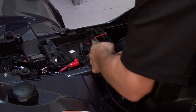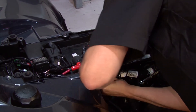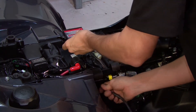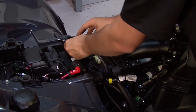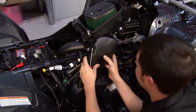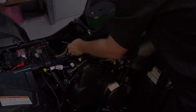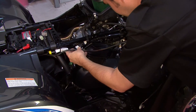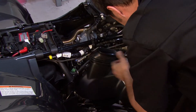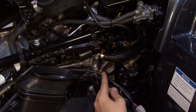We're going to want to store the module right here under the seat so it'll be easily accessible by a tuner or by you. We'll also want to remove the clutch snorkel to ease in wire routing. We'll try to match the stock harness routing as much as possible — we definitely want to go behind this clutch cover, snorkel, and intake. We'll come to our first connection at the bike's rear ignition coil.